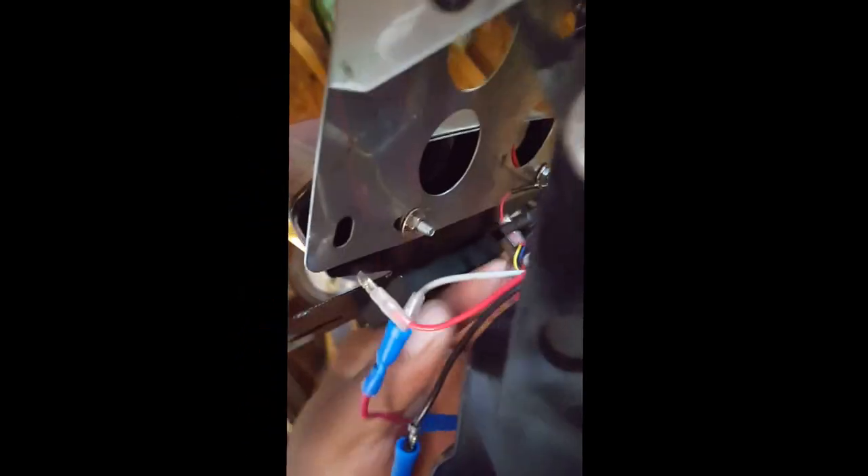What I figured out is basically all I have to do is keep the wires coming from the brake light to the ground and to my brake light set up together, then take the wire I was using for my daytime running light and keep that in series with my brake light wires. It's a little confusing but I'll put out some pictures. Man, it gave me the biggest headache but I'm so happy with it now.